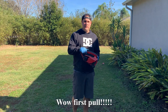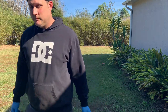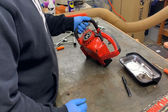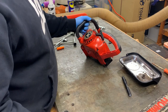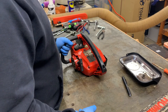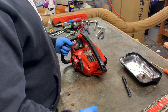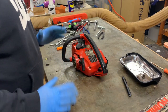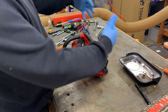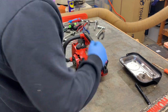There we go! So it fired. We've got spark and we've got probably compression. I'm just assuming that the fuel is bad because of the condition of the gas tank, so I'm not even going to try to run fuel. We'll just start to take it apart. To get to the carburetor on this one, the whole engine and everything has to come out of here — it's kind of goofy — but that's what we're going to do.